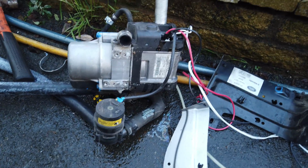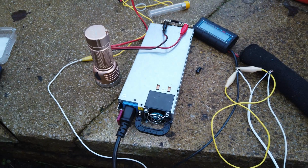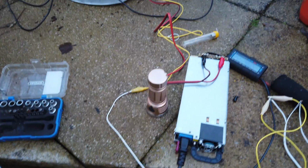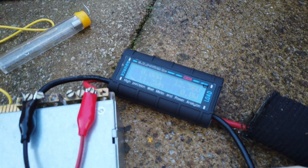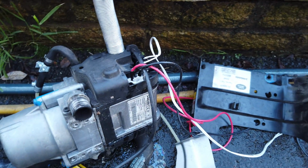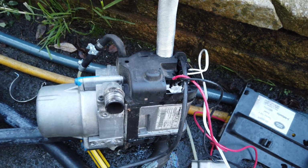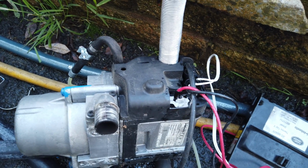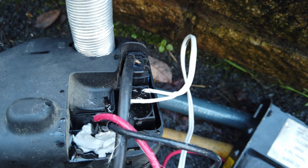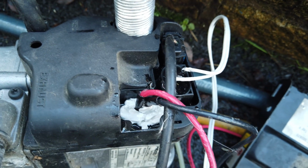I've got it connected up to a HP server power supply, which is capable of providing, I think it's 60 odd amps. Power meter just there, and because these are designed in quite an annoying way, you need a digital signal to turn them on. So connected to one of the pins in there, and I will put a diagram in the description.